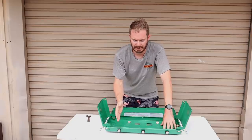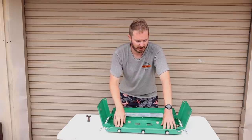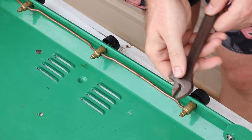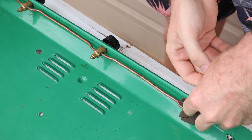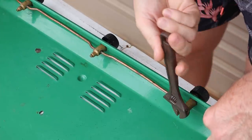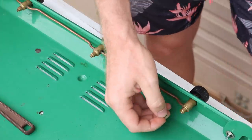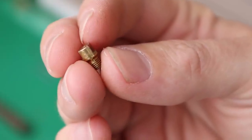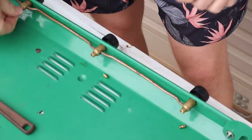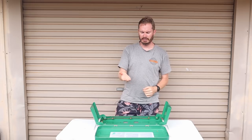Blocked or faulty jets are the biggest cause of low flame, no flame, inconsistent flame, or yellow flame. It generally always comes down to the jets, so you've got to make sure you clean or replace these. If you've got the right size spanner, use that — I don't have one handy so just a little adjustable will do. These are only brass, so they're quite soft; you want to make sure you get that spanner the perfect size. They shouldn't be too tight. Each jet will have a different letter depending on how much gas it lets through that tiny, tiny hole, so make sure you remember which is which. I'm going to take these three into the kitchen.